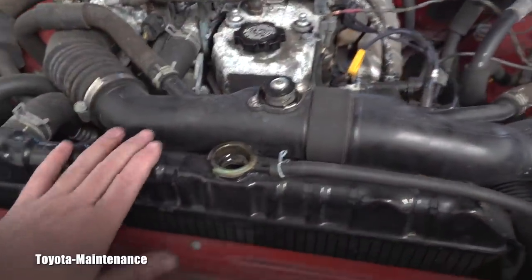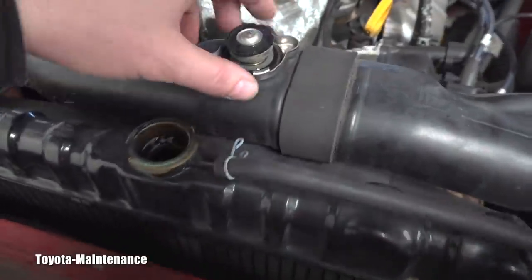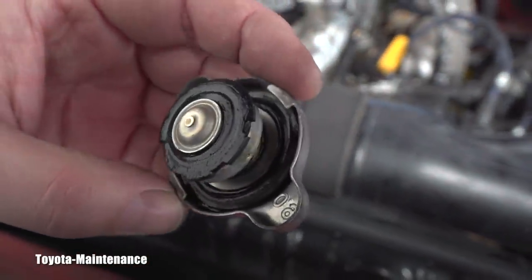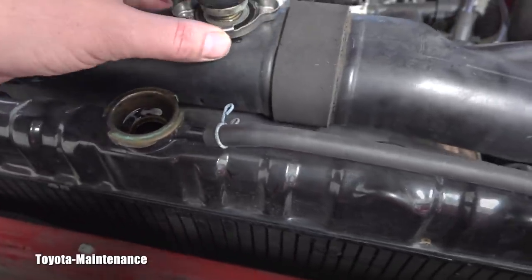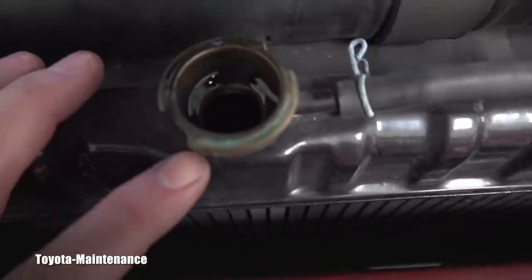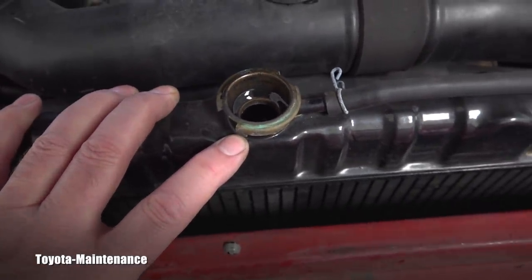It came here for overheating. If you have to diagnose these things, I will always remind you: start at the basics. When the radiator was cold on touch, I knew it would not blow up on me when I removed the cap. I did that, and look — the rubber on the cap is all gone. This cap needs to be replaced, and I can just hope the radiator is in good shape with no cracks and not leaking.